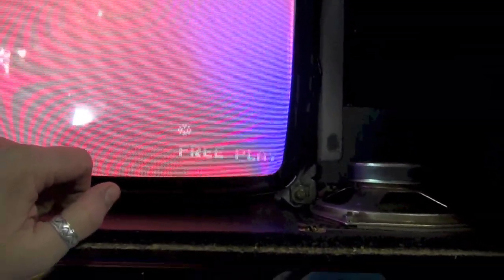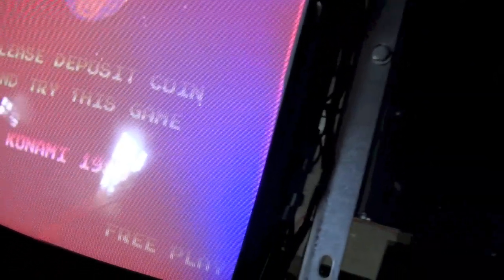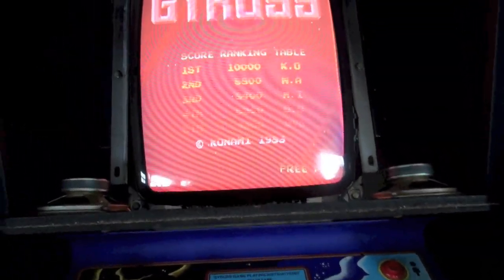With the red cranked up, you can see the bluish color — the monitor has been magnetized or is being affected by a magnetic field. We can try rotating the cabinet to see if the orientation relative to earth's magnetic field changes things. I'm turning the cabinet and the distortion went away — it's gone. However, now this corner is messed up. This might be a case where we can't fix it with the degaussing coil, but we're going to try.